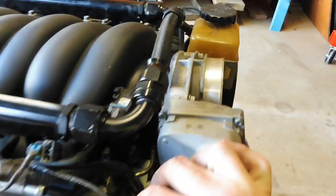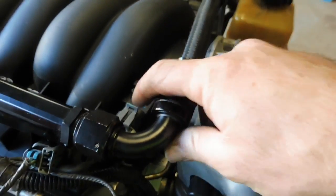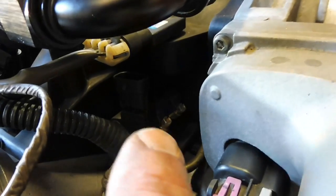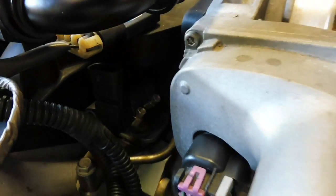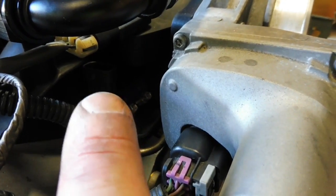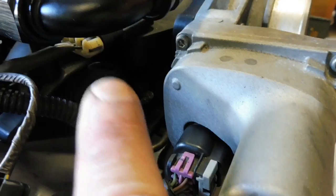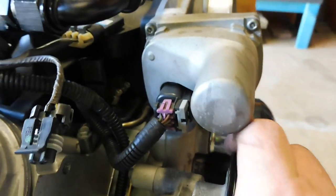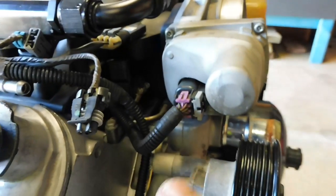Then you're also looking at the manifold pressure sensor, which is the standard location here, which I have plugged into the standard one. But this engine's also got, if you can see in there, a 2.5 bar one into that side port there too. So that plug doesn't suit. In the future I'll have to get a loom from VCM or a plug to change that back over. But to start it up naturally aspirated, which I'm going to do, that standard one will be fine.